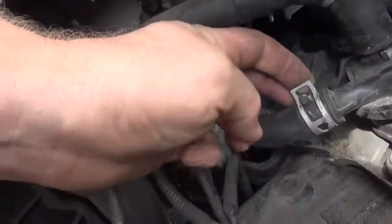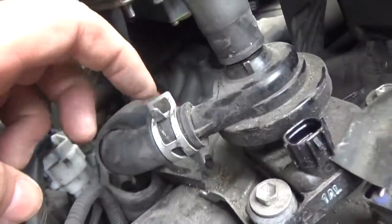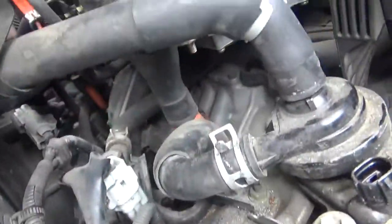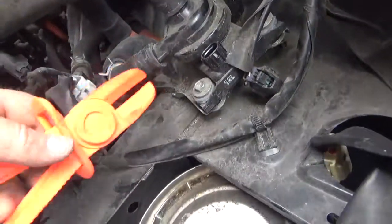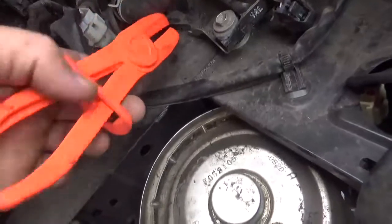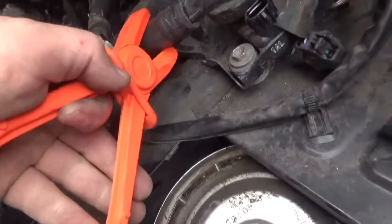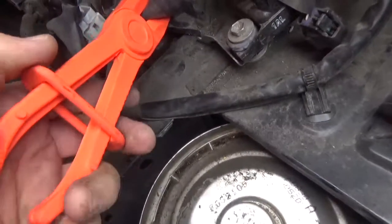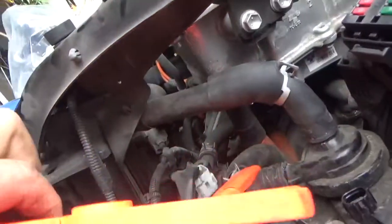that way. Doing it on this one loosens it up because you're pulling it toward that one. That loosens it up and that allows it to shift. So now I'll be able to come in, pinch that, and slide it down. So with both of these slid back, I can come along now and put the clamps on. I'll keep the coolant from leaking out.